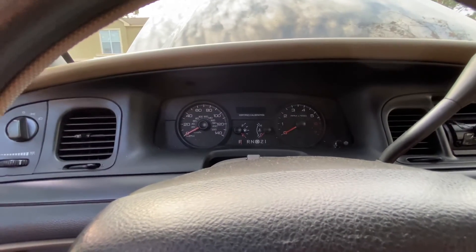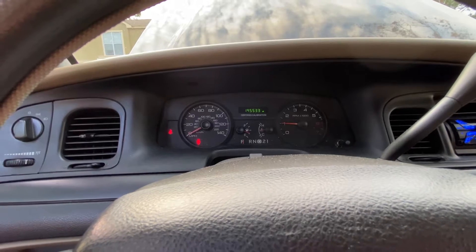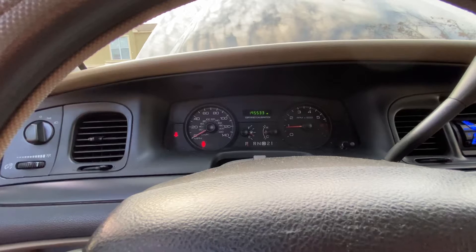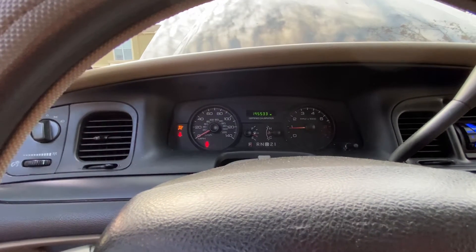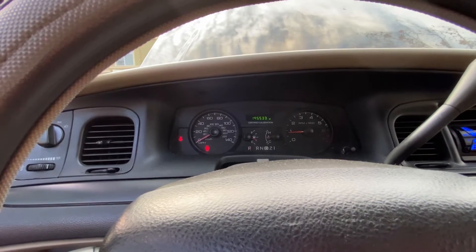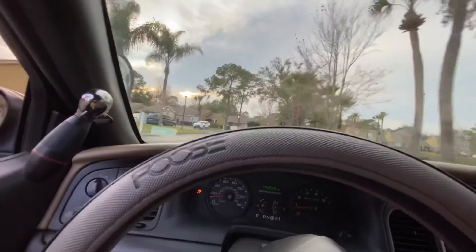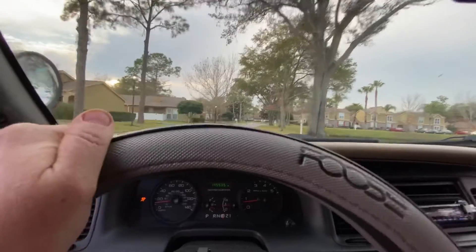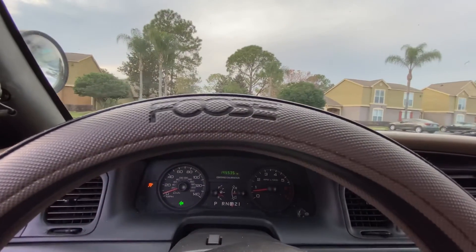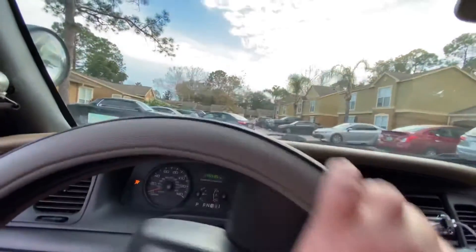Go inside your car, start it up, see what happens. Right now I don't have the check engine light, but it still seems like it might be a little rough, so it might still be the spark plug. I'm going to take it for a little spin, see if the check engine light comes back. If it does, we're going to have to change the spark plug. I took the car around the block — no check engine light came back on. Seems fine, no misfiring, no bucking. That's kind of one of the symptoms you'll feel — bucking, a little sputter if it's misfiring. So it looks like just the coil was the issue.